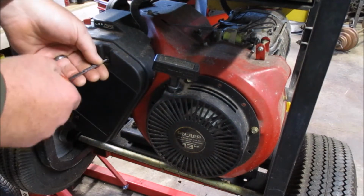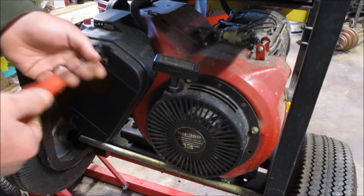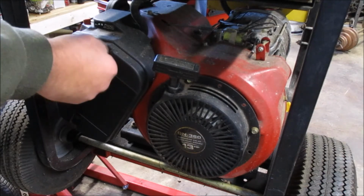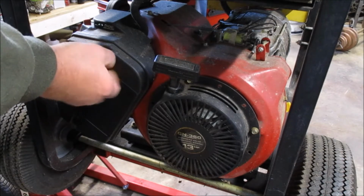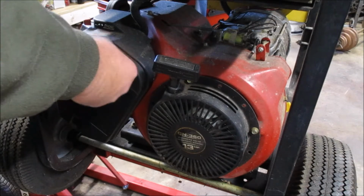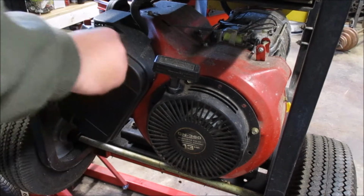I'm going to start right here. Before we are done, I'm going to need to drain everything out of the gas tank right up here. I leaned over it, just took the cap off and smelled it. And you can pretty much name that tune in one note. You can smell it. It's just an awful smell, old gas. It smells like turpentine, or it's a really odd smell.